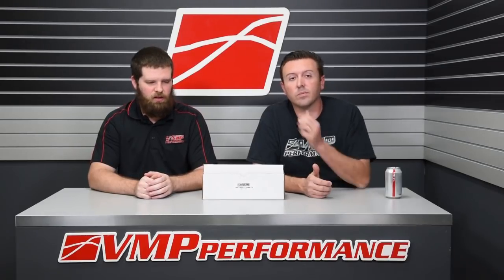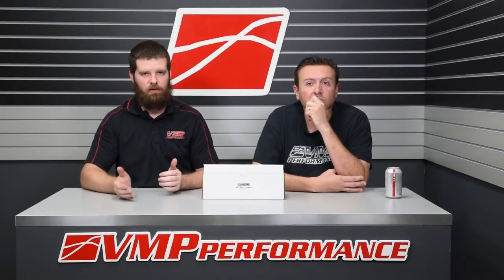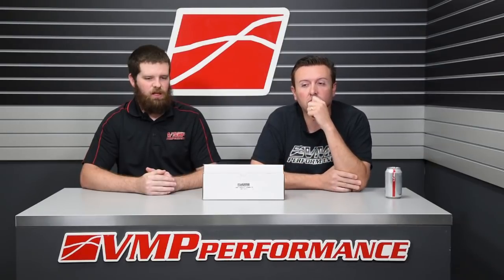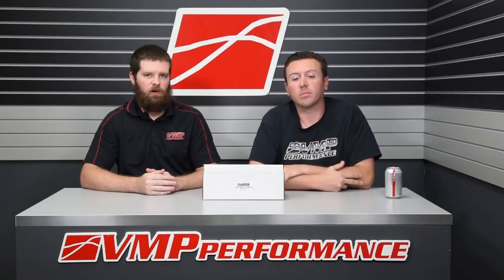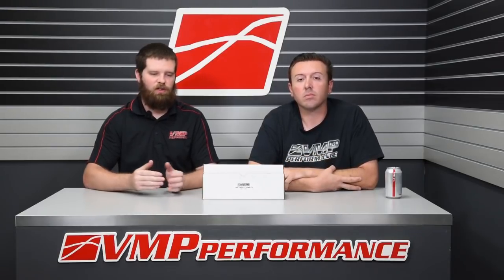If you're half a degree from MBT on the fuel that you're using, there's not going to be much gain going to E85. If you're 6 degrees of timing away from MBT on the fuel that you're using or the boost that you're running or whatever, your gain going to E85 is going to be significantly higher. I'd say that your best bet to determine the benefit or advantage to running E85 would be to put your car on a race gas and get a race gas tune and just see how much power you gain from that.